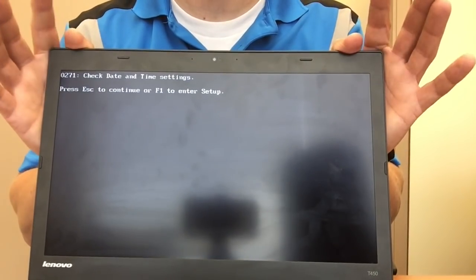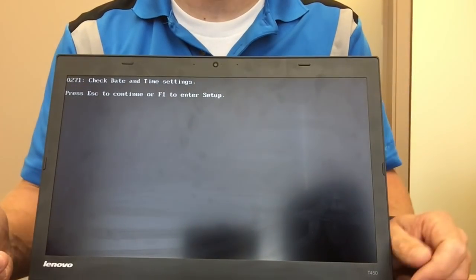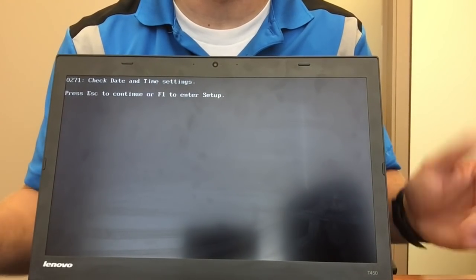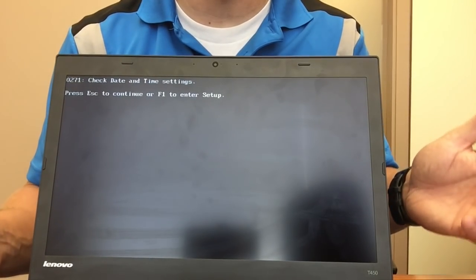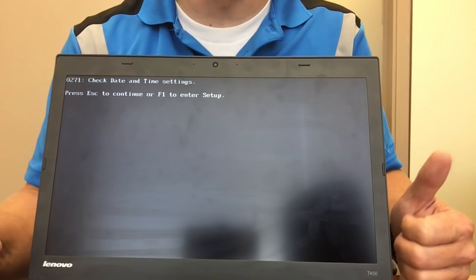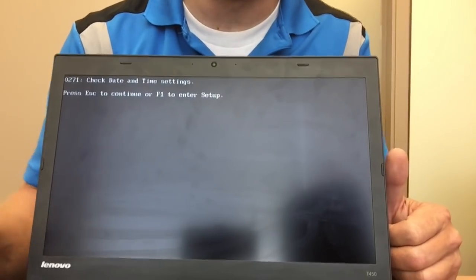This should save you some time from replacing a motherboard. Try these two simple tricks: pull the battery, pull the CMOS. Give it a few moments with each — about 10 to 15 seconds. Then plug the CMOS back in, plug the battery back in, and give it a try. You can also plug the power in while having the bottom off just to make sure it comes back alive without the battery connected as well.